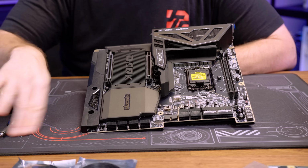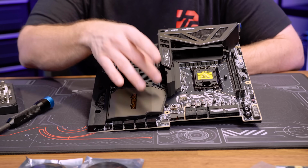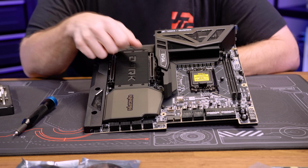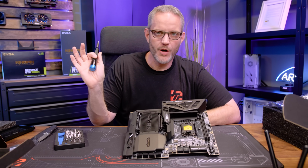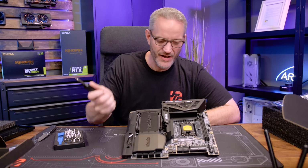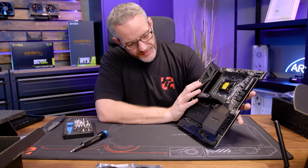Back in the day, when I had like 3 graphics cards on my Classified motherboards, I could turn those off individually if I just wanted to flip off that other card, not unplug the power or pull out the SLI bridge or whatever. I could just turn off the dip switches and then the system would just ignore that card on the next boot, and I could go through and play games with a single card if I wanted to do testing and stuff. It was actually really nice to have. In terms of layouts, I wish more motherboard manufacturers did this.